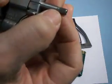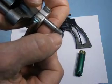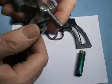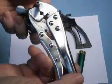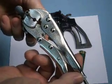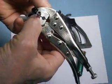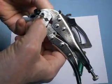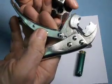You'll notice this one here — some previous idiot had put a pair of pliers on there and screwed it up, and that's the whole reason for this tool. This tool is the finest quality available to do this job. There are other brands of similar tools that grab hold of the extractor rod like this, but none of them give you the power of a pair of vice-grip type pliers like this.